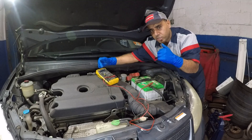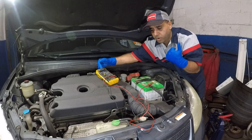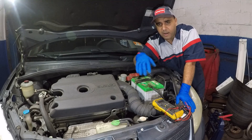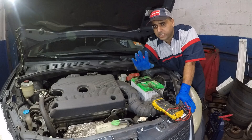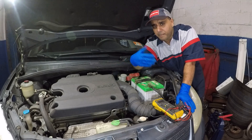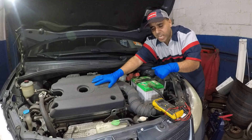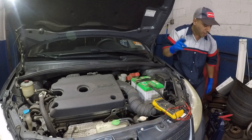Let's take a look — I'm going to bring my camera a little bit closer and check this car. This car is dead, it does not start. I'm going to jumpstart the car. Once I jumpstart the car and take off the jumper box, if the car stays alive — with Toyotas, Hondas, Acuras, even the Suzuki — that's the sign your alternator is providing good voltage and your battery is bad. But we're going to check it further.